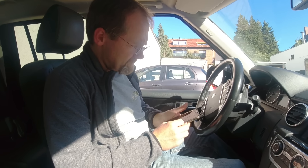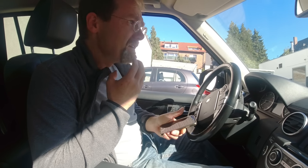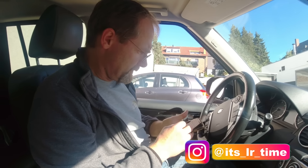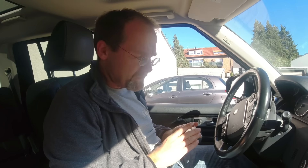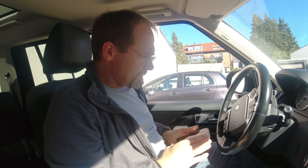Windshield missing sensor — that's bad. Secondary battery component failure. HVAC — nothing bad. So the only real faults are the windshield missing sensor, which might be the light detection or the rain sensor, and then the secondary battery complaint. What we're going to do now is start the vehicle and check how long it takes to get oil pressure.